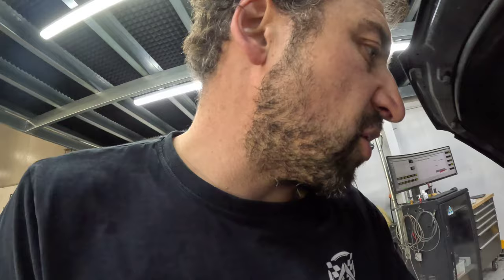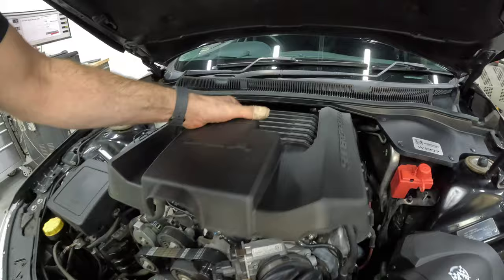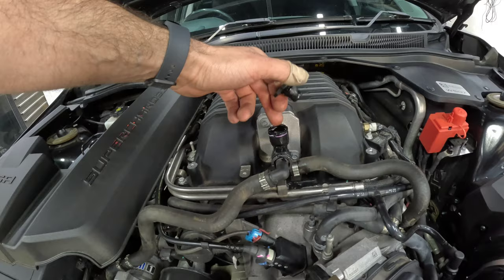One thing I really want to touch on — and we're seeing this a lot with LSAs — let me get the blower cover off. Every LSA we get in the door, they just never seem to have any water in the intercooler system. It baffles me — maybe they've had a crash and the panel beaters haven't bothered to refill the system. If you've got an LSA and want to check: twist this cap here, it comes out, and you can see how water pops out. That's how you fill your system — put a funnel on it and fill it right up with the engine running so the pump's going.